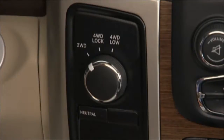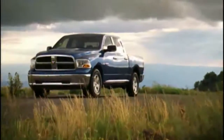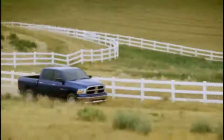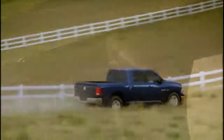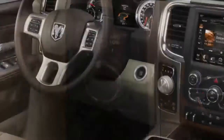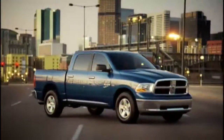To shift from two-wheel drive to four-wheel drive, rotate the 4WD control switch to the desired position. Shifts between 2WD and 4WD Lock can be done with the vehicle stopped or in motion. With the vehicle in motion, the transfer case will engage or disengage faster if you momentarily release the accelerator pedal after turning the control switch. If the vehicle is stopped, the ignition must be in the ON/RUN position with the engine either running or off.